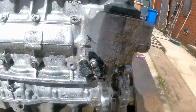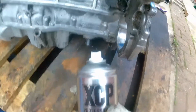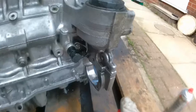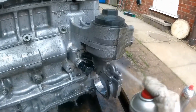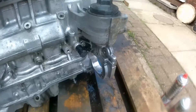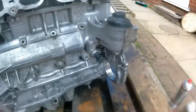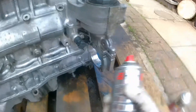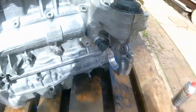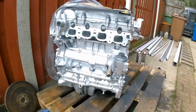I just wanted to show you the benefit of the brake cleaner thing. So what I do first is go over it with some WD-40, or this stuff is quite good with a brush to agitate the dirt. Then we come in with the brake cleaner and you'll just see how it flushes out all the dirt. And then fairly quickly that'll dry off and you're left with the dry deposits of the oil, which you brush off and then repeat the process. Brake cleaner is very good for just flushing out the cleaning stuff you're using to agitate all the dirt off. And that's how I get it as clean as I can before painting.